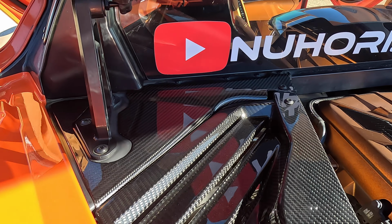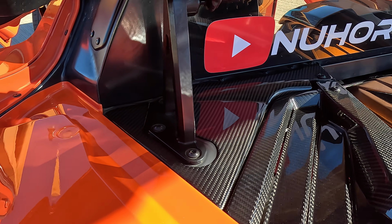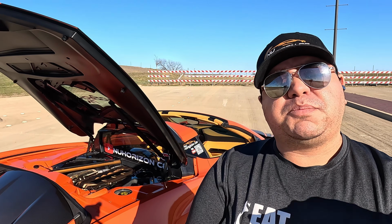The hole's a little bit tight for the bolt to go through, but it does go through. You just have to make sure everything is lined up correctly. If you do that, you're not going to run into any kind of issues getting the rest of it lined up. Originally when I was trying to install this, I tried to line it up using the back edge. It's actually easier to line it up with the forward edge, the side that is closest to the cabin. It is actually easier to fit it in that way and then lay it down.